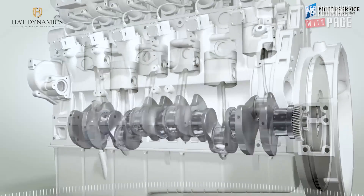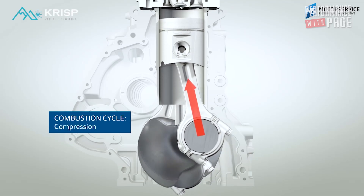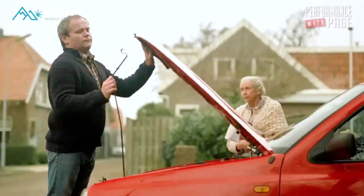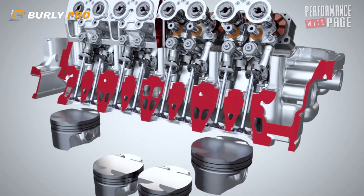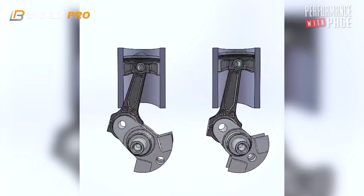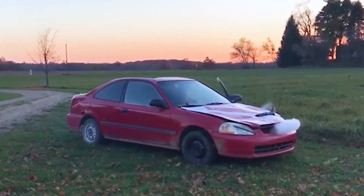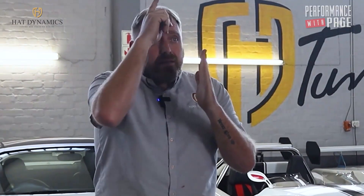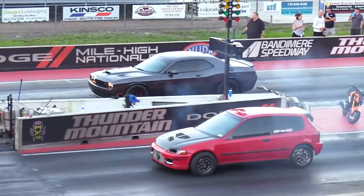If your bearings are good and the engine can rev, the conrod's not going to come out the side. What happens with smoking is that the conrod stretches as you rev — that half a ton becomes one ton and everything — and it goes higher in the bore. The worst car to go racing with if it's done lots of mileage is the old lady's car that's never been revved. The piston ring gets to a certain point in the top of the bore at low RPM and wears a ridge. The first time you rev that engine to 7,000, it goes higher, hits that ledge, snaps the ring off. If you've got an engine that's been revving its whole life, the ridge is higher and you'd rather have that one.